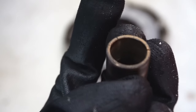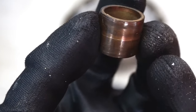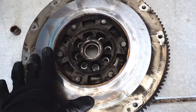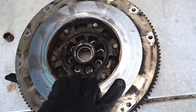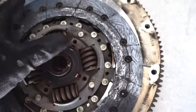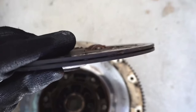This is the pilot bushing — so many cracks all around. That's pretty hectic. It was lucky that I actually changed it now because if not, this would have gone out. This is the stock dual mass flywheel — super thick. Actually it's not too bad for 13 years. Obviously it's not great, but I can definitely say I got my money's worth out of this stock clutch.